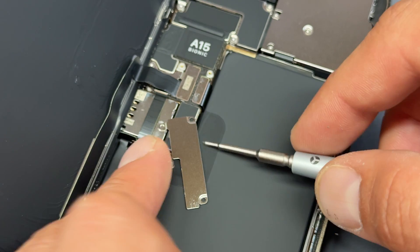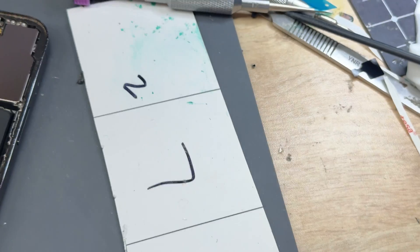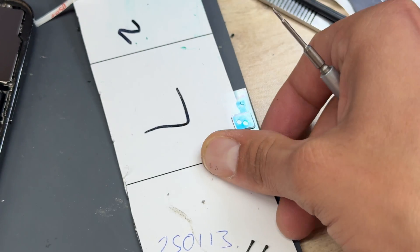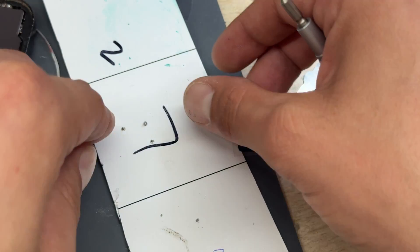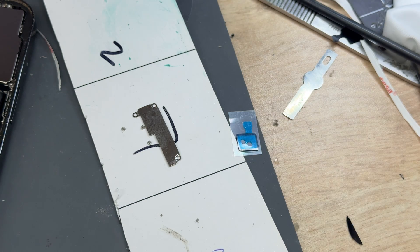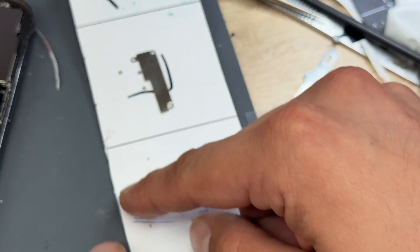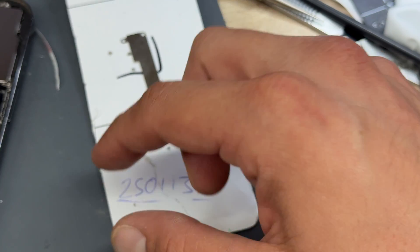The shield comes off. Just get it out of the way. I've got this little piece of magnetic whiteboard — you can see blades and screws are already stuck to it. I'm going to remove the screws and lay them out in the same order that they came out, so those three screws go with that shield there. Notice how it's roughly the same sort of shape as a mobile phone — I'll lay them out along here, all the screws for the bottom, so that I know where they go back into the phone.